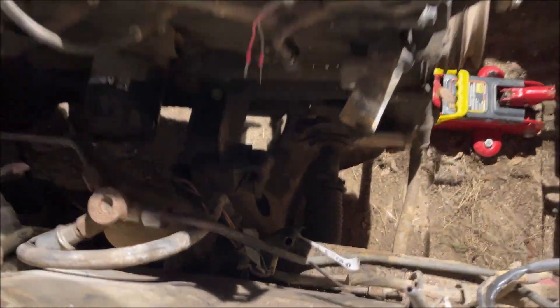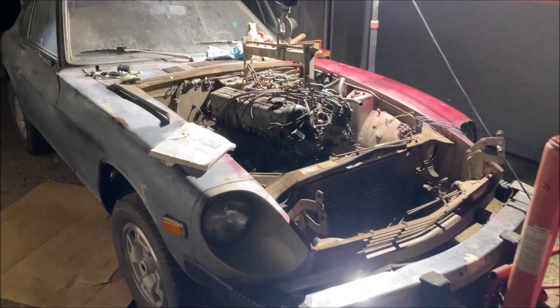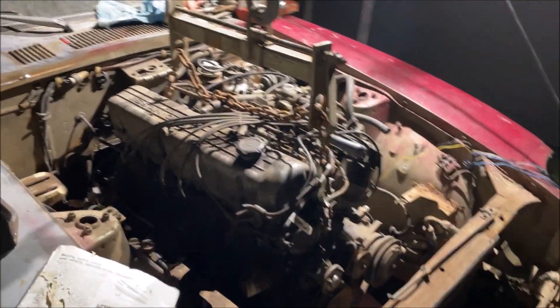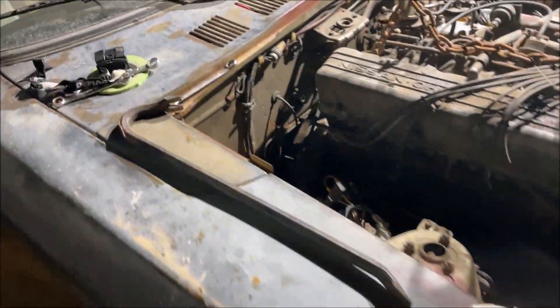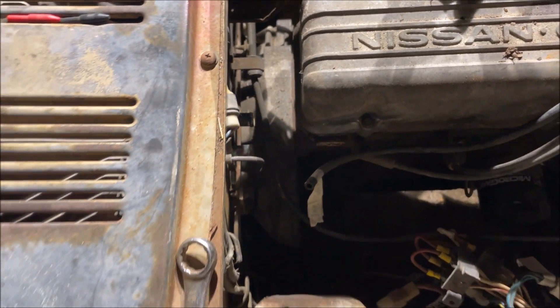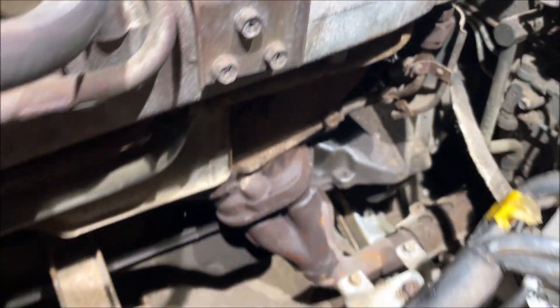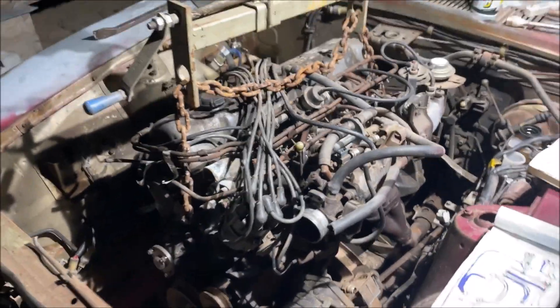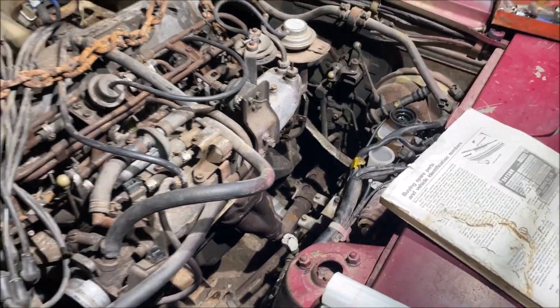The engine is clearly up and ready to come out but it's still hanging on the bell housing — I've got to figure out what's going on. I started pulling this at about 2:30 and it's now about 7:30. Taking my time and I haven't damaged anything that wasn't going to break anyway. I'm assuming there are some hidden bolts in that bell housing. I did get all three bolts off the exhaust manifold and it's sticking on there too. I'm going to finish pulling it first thing in the morning.